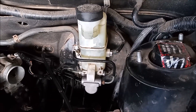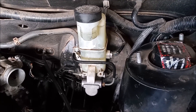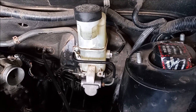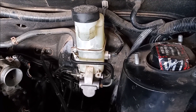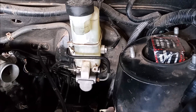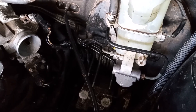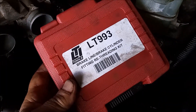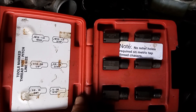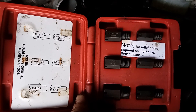Here it is back together. I cannot emphasize enough that when you reconnect the fittings to the master cylinder, be careful not to cross thread them — always start them by hand with very little pressure. My tip is to turn the fitting counterclockwise first until you hear it click. You'll hear a tiny little click and you'll know the threads have engaged, then turn it clockwise to secure it. If you do manage to cross thread either one of the fittings or the master cylinder itself, that's why we have these kits for re-threading brake lines and fittings. This kit has tools for several different sizes — the size on these Toyotas is 10mm with a 1.0mm pitch. I'll include a link to this kit in the video description.